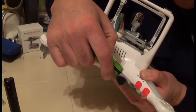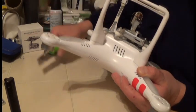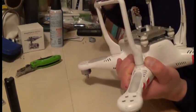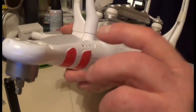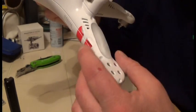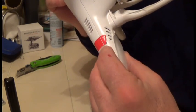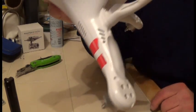Do it on both sides as well — that's going to separate the red ribbon from the bottom and top of the Phantom. You'll notice this ribbon is already falling off; that's because the first time I opened mine I peeled it all the way up. Don't peel it up — just slice it with a razor and it works much better.